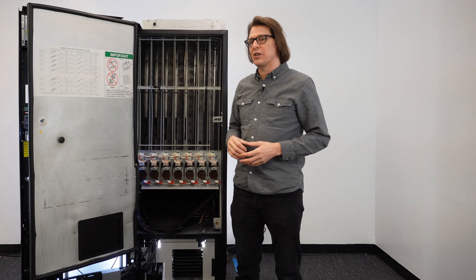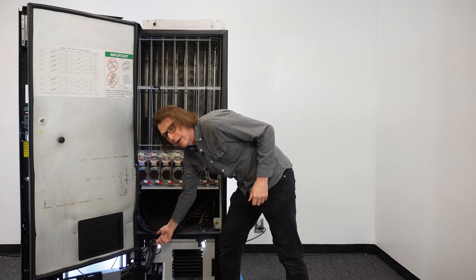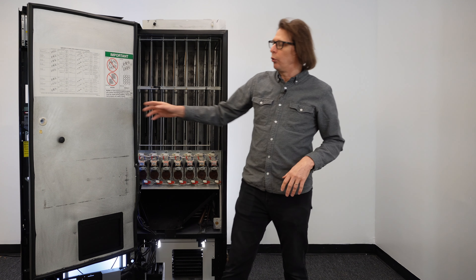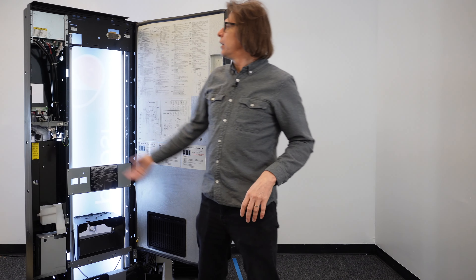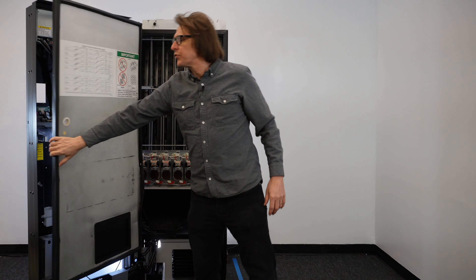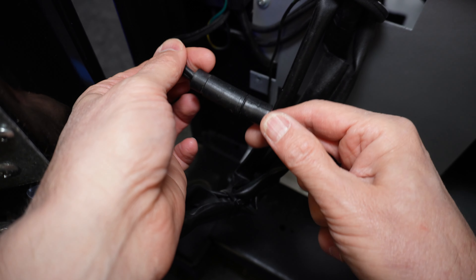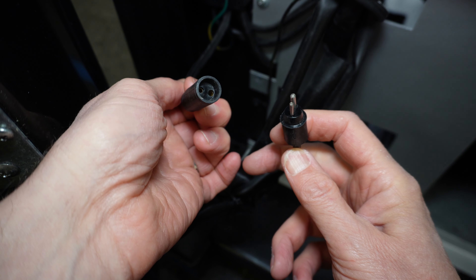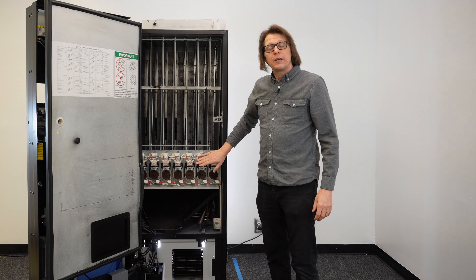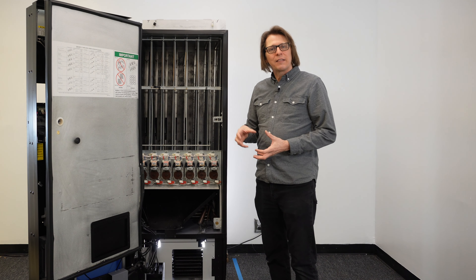To remove that jammed product, you're going to want to remove power from the machine. You can do that by unplugging the machine from the wall. There's a stack plug at the bottom left-hand side of most of these Dixie Narcos. You just pull that apart and it will kill power. Or you can kill power at the control board using the power plug located there to separate the two wires. I'm going to go ahead and use the stack plug down at the bottom and unplug that.